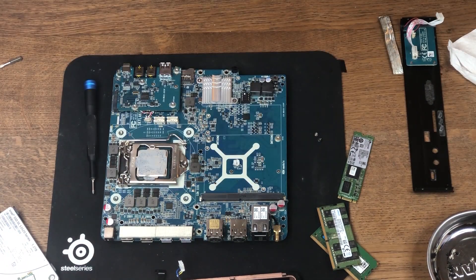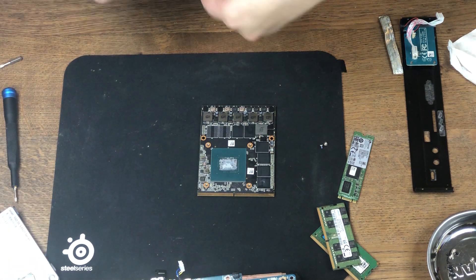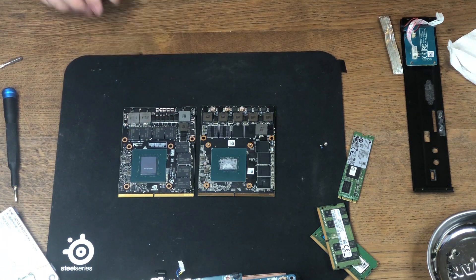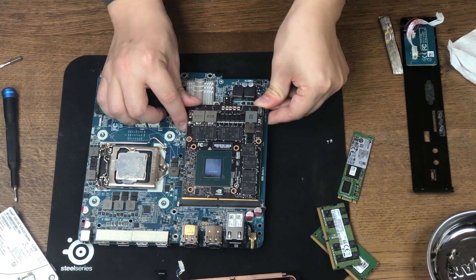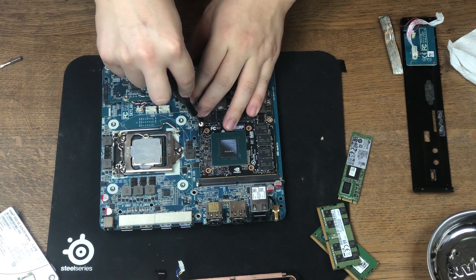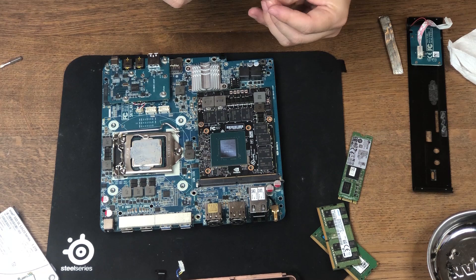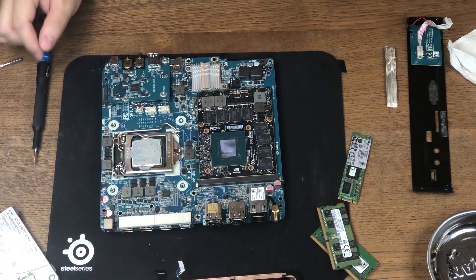Here it goes — here's a quick comparison between our video cards. You can see they are exactly the same size and have the same socket. The Quadro P4000 actually has a bigger GPU because it is based on GP104, while the GTX 1060 is based on GP106. Now let's plug our new video card into the MXM slot. It's pretty simple — just like you would on a desktop. And we put the two screws back to hold the video card in place.